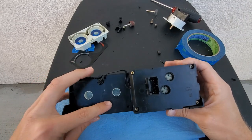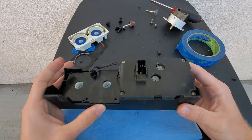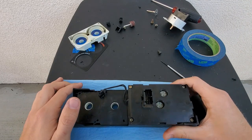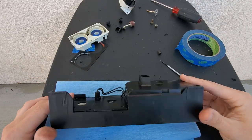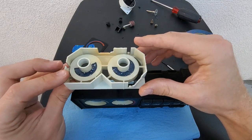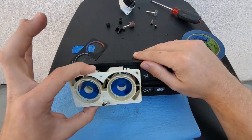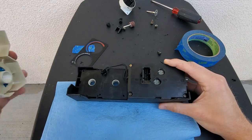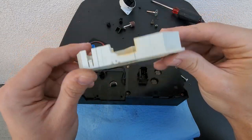We just finished mounting the mounting plate onto the back of the climate control unit using plastic bonder — make sure you use plastic bonder since it gives the best joint with these two ABS plastic parts. Don't apply too much glue and turn it clockwise when installing. You can go ahead and install your mixer unit now — just put the two screws back in. One important thing: you need to make clearance for the stud that will now be poking through. Use your Dremel to cut that part out too, because if you don't, the unit won't fit all the way in. If you don't take the fascia out, all that debris gets stuck on the back of the blue sticker.